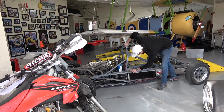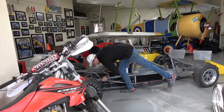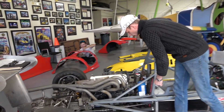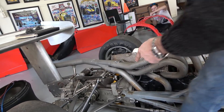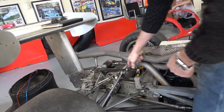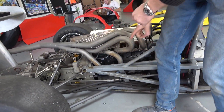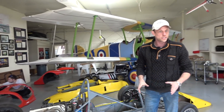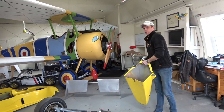The Prototipo weighs the same as the Continental despite being a bigger, higher-performance car because of the extensive use of carbon fiber, and because the transaxle and engine do double duty as drivetrain and part of the chassis, saving a lot of weight. The Continental, by contrast, has a square steel tube frame that is either brazed or welded - the English were into brazing back in the day. Looking closely, the transaxle on the Prototipo is partially stressed, with suspension arms mounting to the front and back of it.